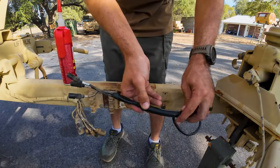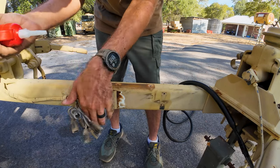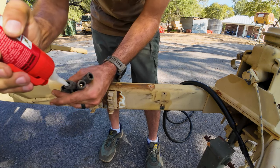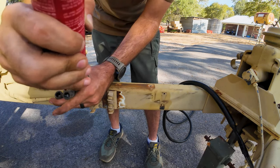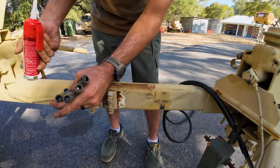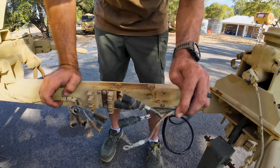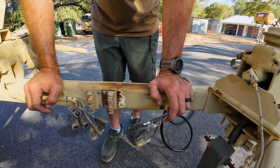The next step is just connecting everything here and putting a little dielectric grease inside the connectors — even the ones you're not going to use — just to protect them. If for some reason you end up using them in the future, it's not going to hurt to just gob the inside because if you do need to disconnect them down the road, it'll make them disconnect a lot easier. You only really need to do one side because once you shove the other one in, it puts the lubricant all over the place. The reason why you reuse the old harness is now you simply match the numbers back up like the military would — that's why you confirmed that you had the numbers readable.